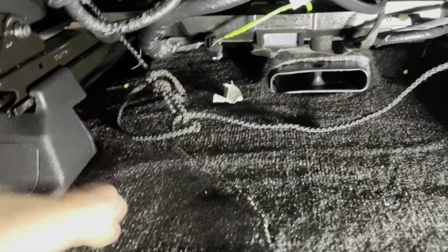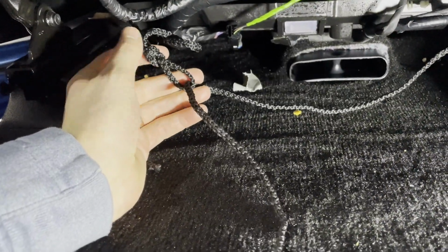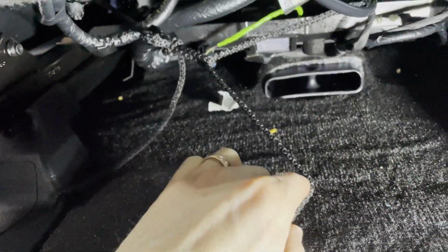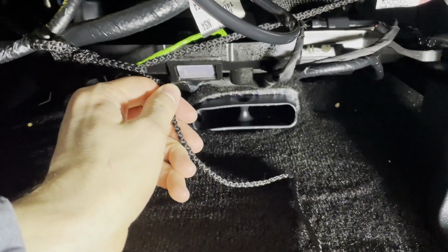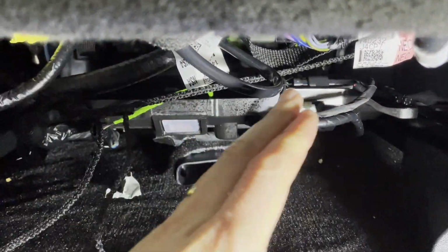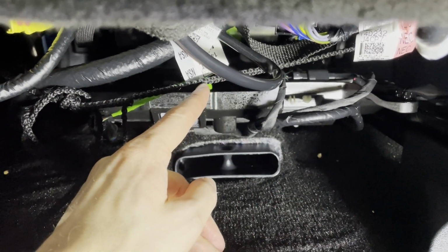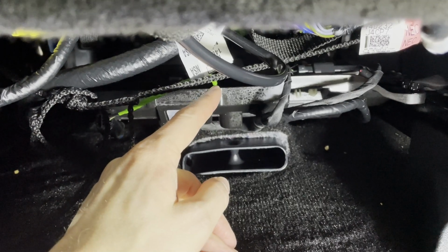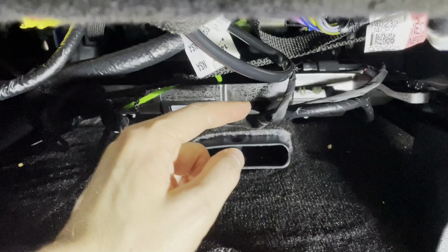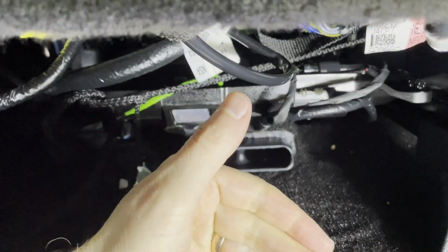So the next step is to tie a loop in one side of the cord like that, right, that I've done, and then take the other side, go through the loop, and then we're gonna tie this up nice and tight. And like I was saying earlier, on this seat, since we don't have buckles on the front where the straps are going up to the front, we're gonna need to make sure that this is nice and snug tight, more so even than other seats. So what I'll do is I'll tie this once, and then I'm gonna go up to the front, pull on that, kind of pull out any excess out of the string, and then come back and retighten it.